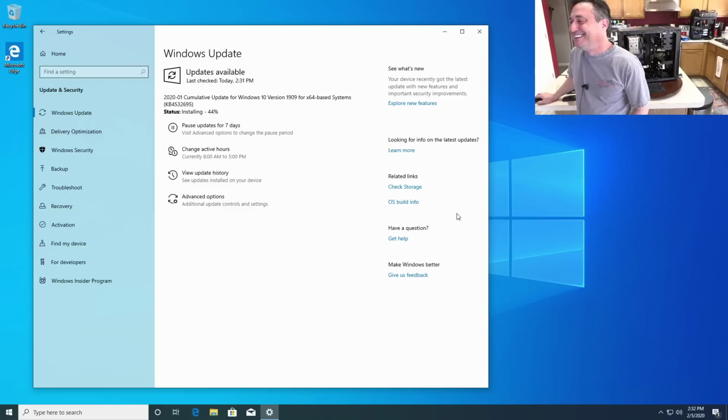Karma says, can you help me? I updated my Windows, and after that, it started crashing, and then I updated my BIOS. It just sounds like you either have an incorrect BIOS setting, so you should restore your BIOS to default settings. You don't have to restore the version, but just make sure you load the default settings. And then run the memtest. You probably have some bad RAM. Most crashes are caused by bad RAM. Many of you watching probably have bad RAM right now, but you're not hitting it yet.